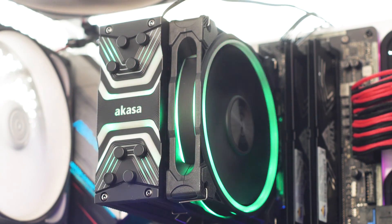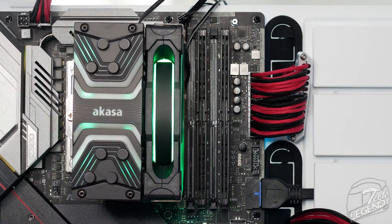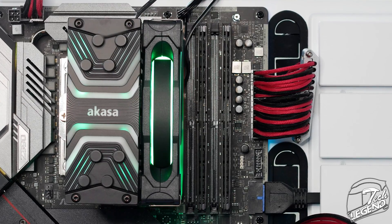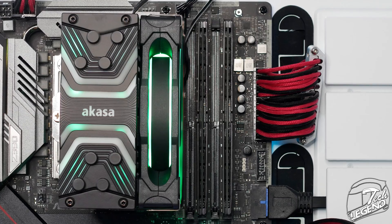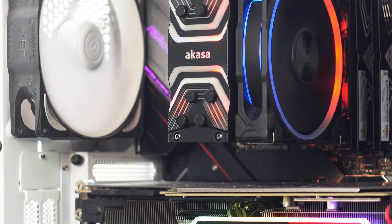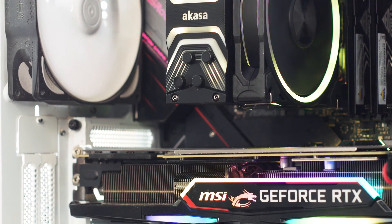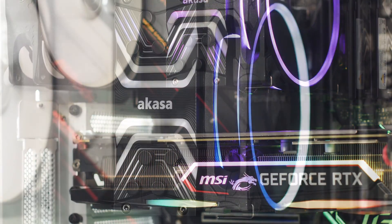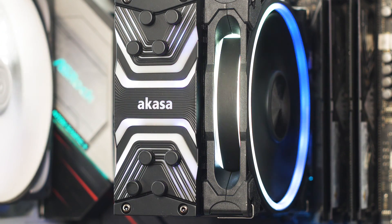With the Soho H4 installed on a standard ATX motherboard, this CPU cooler isn't really that big. In terms of clearance, the front fan does not reach the RAM slots, although some wider-than-average RAM kits might have issues. For graphics card clearance, the space between the backplate of the graphics card and the side of the heatsink is 30.4 mm, which is adequate, though this will vary based on your motherboard and graphics card.